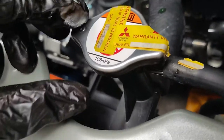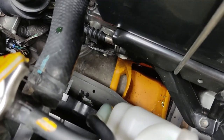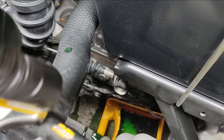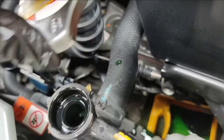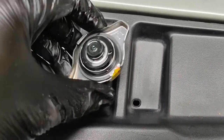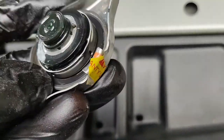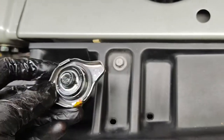Now open the radiator cap — you'll see the flow suddenly increases since it's pressurized inside. Open it slowly and carefully. You can see it bubbling up. The stock coolant is actually blue, but since I'd been topping up with green coolant, it turned green. Now the cap is fully removed. This is also a good time to check if the radiator cap is in good condition — no damage, leakage, or deformity. It's very important because it plays a big role in the cooling system. In my case it looks fine since the car is still relatively new.